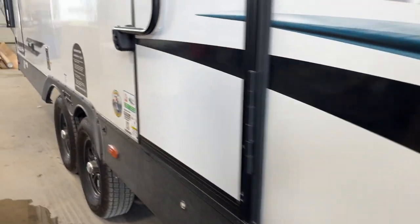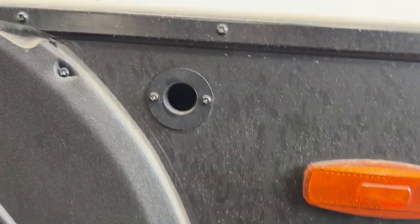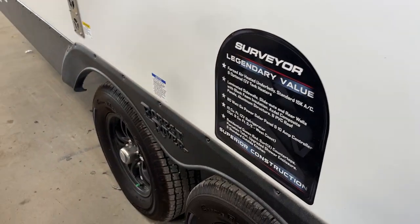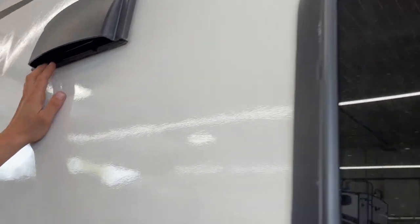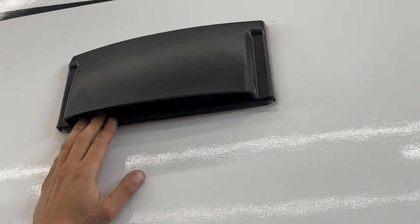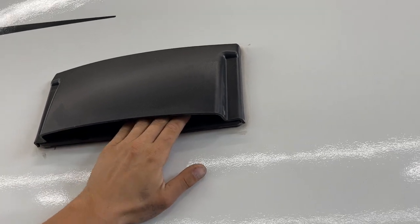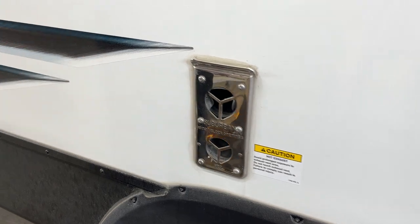Towards the back, you get your entrance. That hole right there is where you stick one of your rods — that's your manual override for your slide out, so if your batteries die, you can still run it in or out. Up from there, you'll find two exterior speakers. In the center, you get your porch light. Beside that, you get your stove vent — the propane stove puts off fumes when in use, so make sure this flap is opened up with the fan inside turned on to evacuate fumes. Once done, press it back into place and it clicks in, preventing dust from kicking up while traveling. Down from there is the exhaust for your furnace — if you're running the furnace, make sure that's not blocked off, as it does get hot.